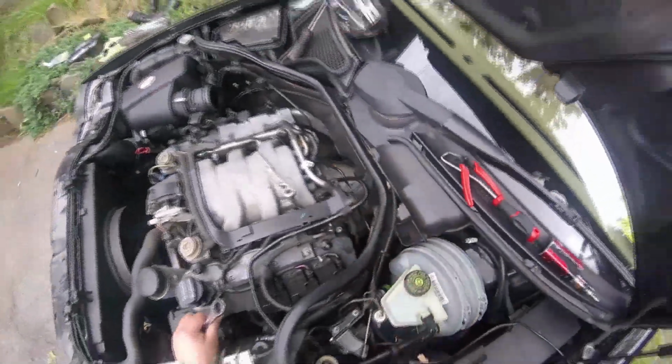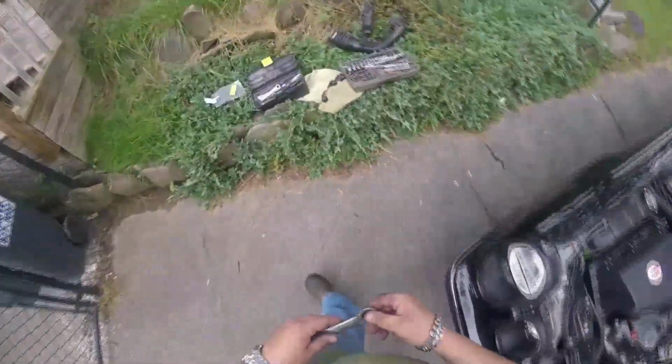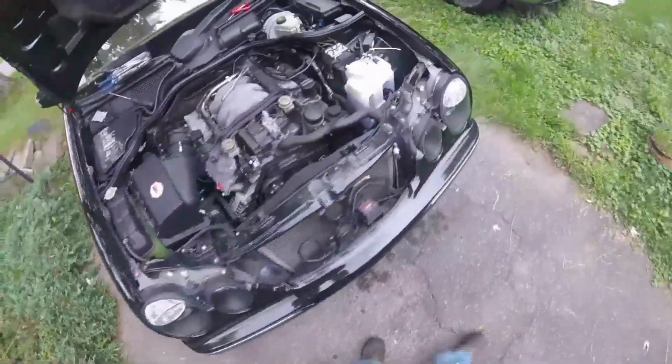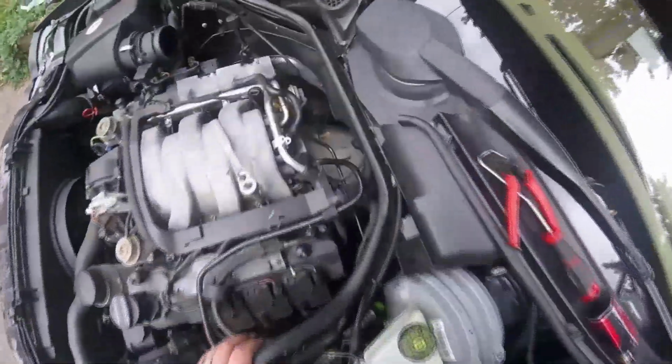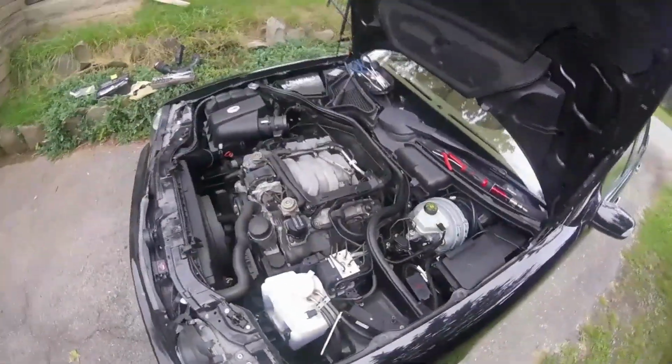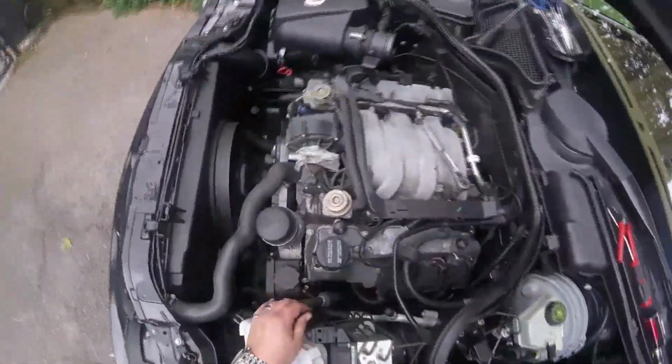That's why I disconnected the battery. I got a little gas coming out of that fuel rail. I didn't pull my fuel pump fuse and run it dry, because I had no real pressure on it. Just a little bit of residue laying in there. Engine's not hot. Make sure you don't do this on a hot engine. You will have a fire.